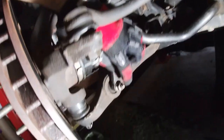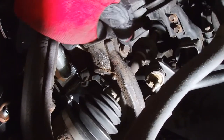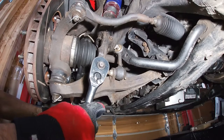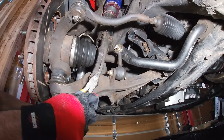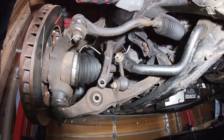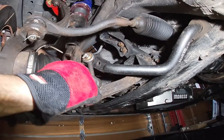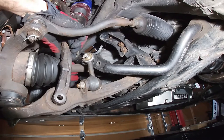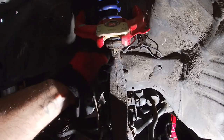We're going to begin by removing the fork on the bottom of the coilover. It's going to have two bolts — one that is connected to the vehicle and one that's connected to the coilover. After we remove the fork, we're going to go up and remove that ball joint from the top of the spindle. I'm using the Skunk 2 arm, so it's just slightly different than the OEM ball joint. Just remove that nut; I used pliers to help push the bolt out as it was spinning. Just wiggle that off — it might take a bit more. Just move the fork out of the way; you don't need to remove it from the car.